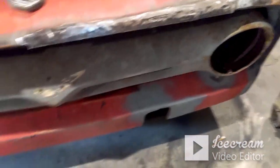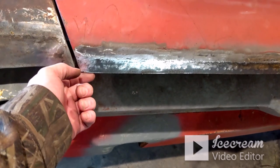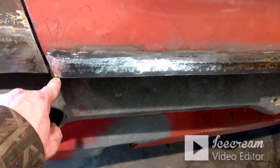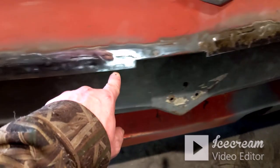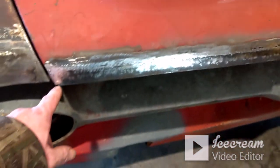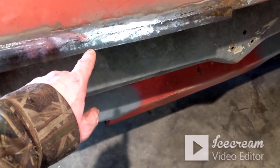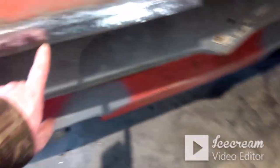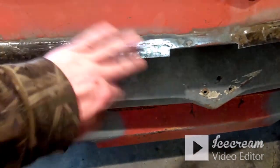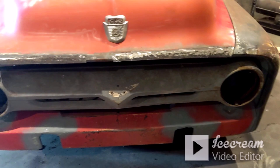And what I'm going to do, I think, is take the hood off the truck, flip it upside down, and then run my filler piece to finish off the bottom side. I'll cut it out good, and I'll take a good flat edge and mark from here straight over to here so my line is good on both. I'll do that with a straight edge. I may put my piece behind before I cut and then weld this outer edge after I cut it, and then just grind that rolled edge right there into it. But I think they look really good, being that they were really, really bad.